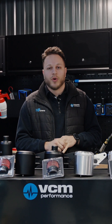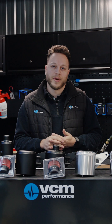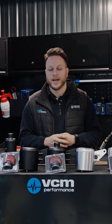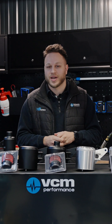Some of you are probably wondering, what is a catch can and what is its function? To put it simply, it catches crankcase ventilation and blow-by gases, whether it be oil, fuel vapour, or even just moisture, from entering your intake manifold, cycles it through the catch can and then feeds clean air into your engine. Depending on how you have it plumbed up, there are a few variances to that, but in short, that is what a catch can does.